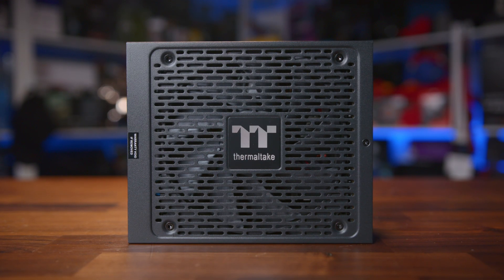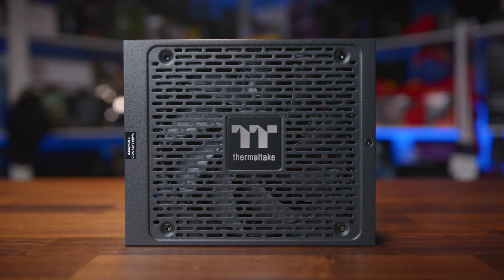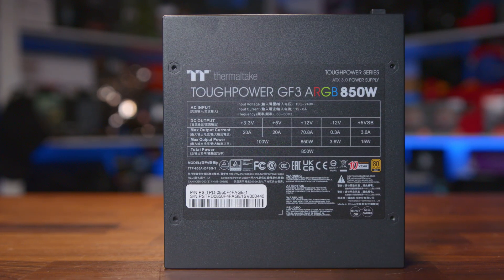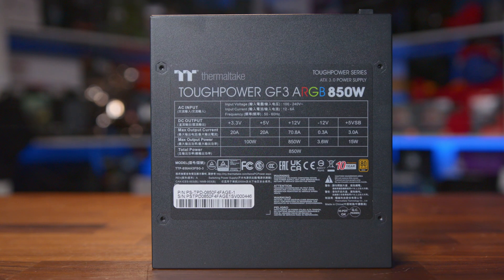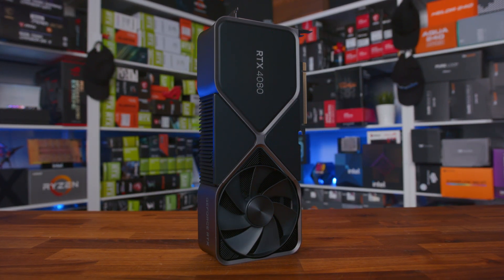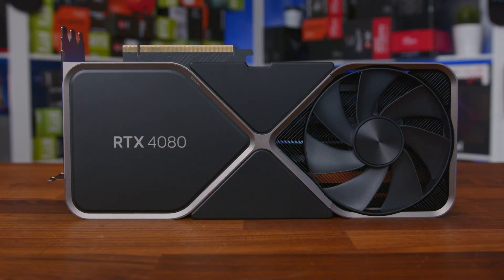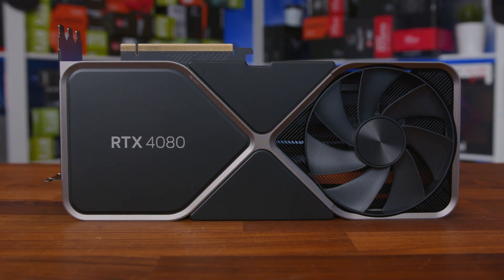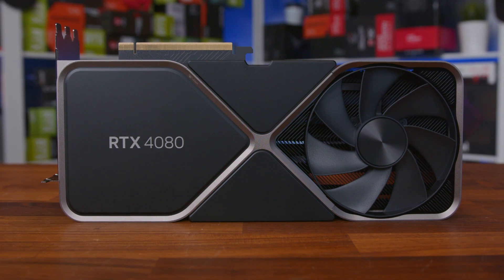While PSU brands have taken the last two decades to perfect their units with increased efficiency, higher wattages, and making them run cooler and quieter, there hasn't been a huge jump until now. With the release of the RTX 40 series and their increased power limits and those nasty transient spikes, something needed to be done to cater for this next level of GPUs and how they receive power from the PSU. And that's how the ATX 3.0 spec came about.